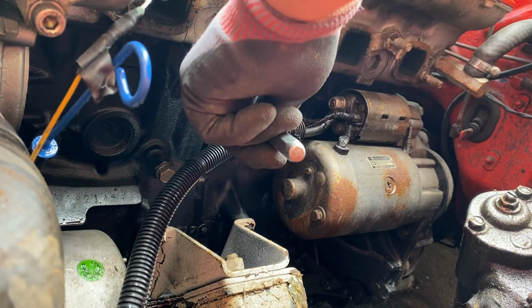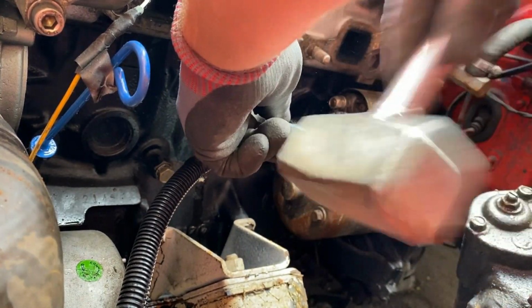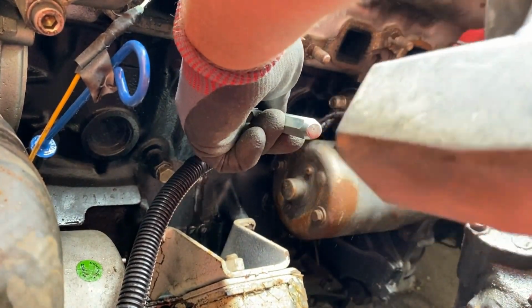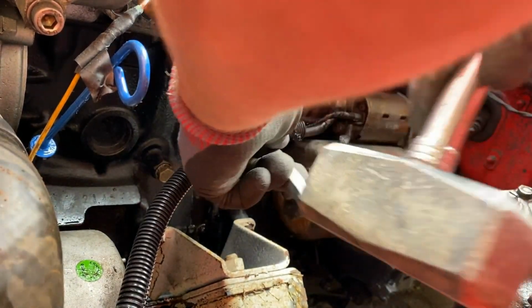And here's the culprit. One of the freeze plugs had eroded all the way through, and when I flushed the system, it took away the rust and dirt that held it back together, and it threw up all over the manifold. So I started punching it out.